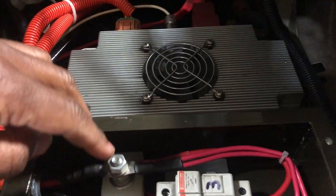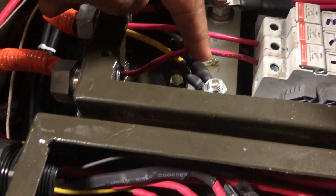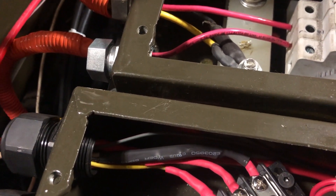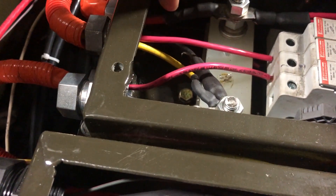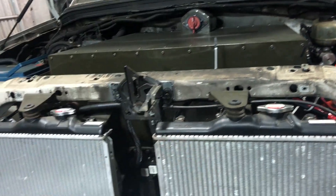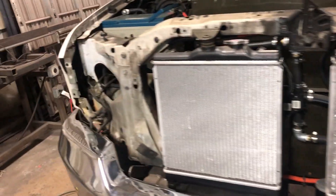You'll see two wires coming out — one is the 400-volt hot and ground coming in, and I know this one going out goes to our heater, which is down in there. That heater heats the batteries and the cab. Then we have a Tesla splitter which takes that and divides up the hot glycol to send it to either the cab, the batteries, or both, or whatever is required.